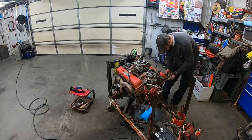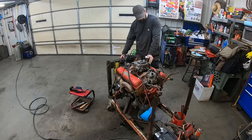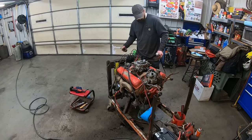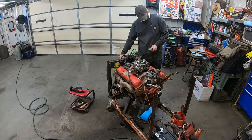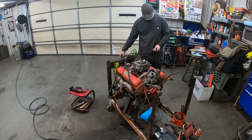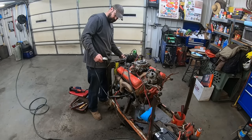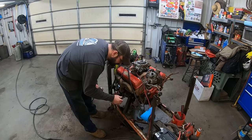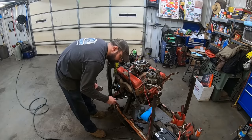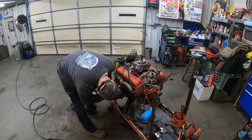95, 50 actually. Oh yeah, it's just wide open. 70. Maybe these rings just sat too long. 50 as well. 50 again. Man, it sure felt like it had some good compression. I was almost disappointed at that 95. No, I'd kill for a 95.